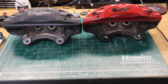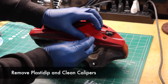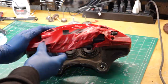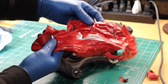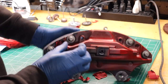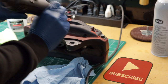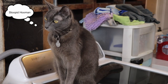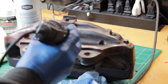Here are the front calipers — the one on the left is how it should look after the Plasti Dip is off; the one on the right I still need to work on. This was definitely one of the things that slowed down my project, but thankfully you probably won't have to deal with it. Plasti Dip needs many, many coats to peel off like this. On the front I got four to seven coats on there and it came off pretty easy, but towards the back it was harder to get my spray can back there, and this stuff got harder and harder to peel off. Eventually I had to bust out the power tools — I used a Dremel with a wire brush to help get that remaining Plasti Dip off. A little bit of acetone, brake cleaner, or mineral spirits help soften the Plasti Dip if you have this problem.